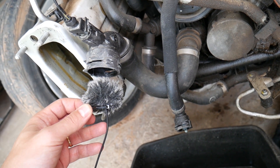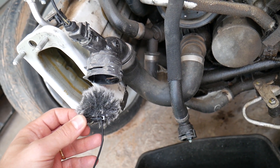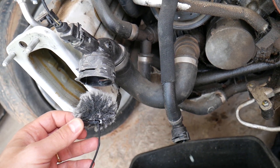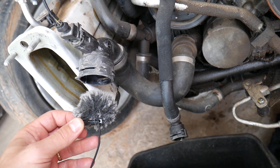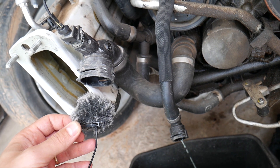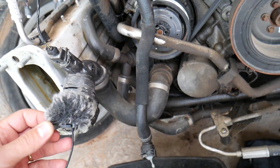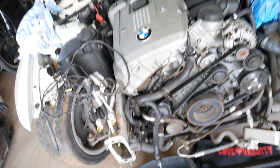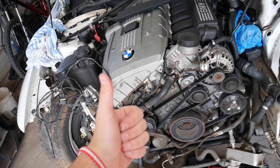This on/off cycling is the procedure used to bleed the cooling system, but you can also use it to see if your water pump is working, especially if your car is overheating and you think you have a bad water pump. Even though it doesn't tell you 100% if the pump is fine, it will definitely give you an idea if it turns on and off. Hopefully this video is helpful to anyone with a BMW 5 Series — let us know if you have any questions, please subscribe to the channel, and see you next time.